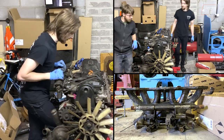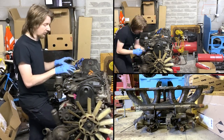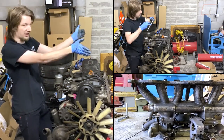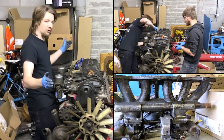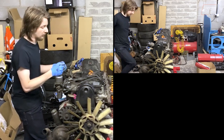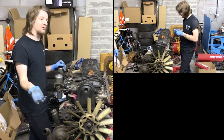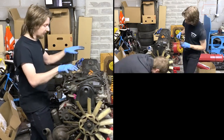It doesn't help with these carbs that the manifolds on them seem fairly nice at a very quick glance, but actually the gas flow through them isn't very good. The manifolds are a two into six design, so it's split — you've got two airways into the carbs. Cylinders two, three, four and five — the middle four — get quite nice airflow. But cylinders one and six at the very front and back of the engine have runners that are a lot longer and a lot more aggressively slanted out to reach, so I would wager they don't get such good airflow or fuel mixture. Something will be iffy with combustion in those, and I guarantee Rover will not have accounted for that when designing the camshafts. So hopefully going to individual throttle bodies should give us a natural breathing improvement and much more even combustion.